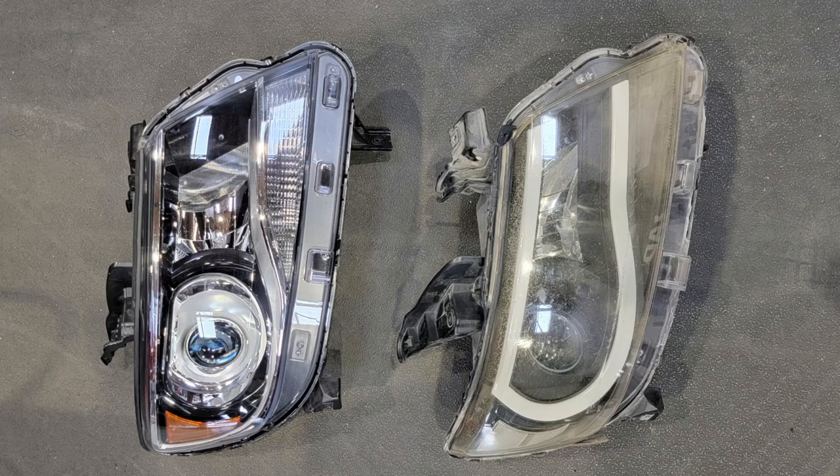I'm going to take a moment to explain why I'm doing this headlight replacement — backwards from stock to aftermarket to stock again. On the left is the original housing I took off about two months into ownership. The assembly on the right is a product made by Lumen that has aged only about one year, and you can see how poorly it has endured. There's been no exposure issues from misuse or abuse — we're looking at delamination, yellowing, inferior materials, and a fracture that separated the back of the housing from the front, which eventually caused water and dust intrusion. That aftermarket product just didn't live up to the task.